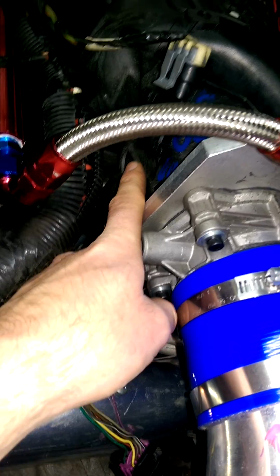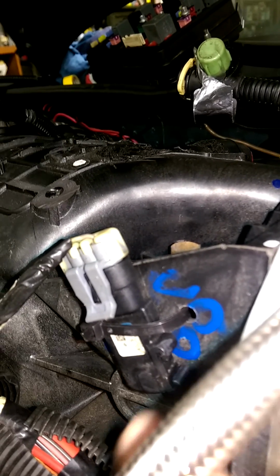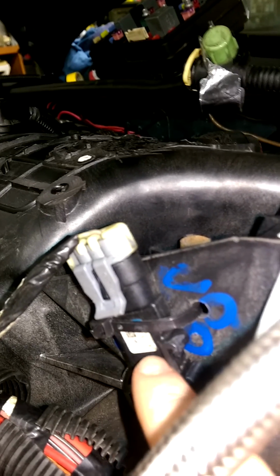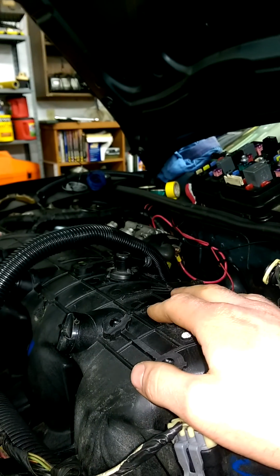As you can see, that one's not drilled out or anything, but what I did over here is mount my MAP sensor and just zip tied it. There's already a preformed hole here, and I drilled through until I got inside the actual intake manifold itself. That diameter I made a tad bit bigger. I went with the pilot drill, then I went with the bigger drill. Since I was using a hand drill, I didn't want to wall it out, so basically I made it a diameter where this would fit in nice. So I did that, plugged that, made this. Finished, ready to go. You'll have to take all the crap off the top of this. This is not finished, by the way. I was up for 24 hours finishing this thing to get ready for the dyno.